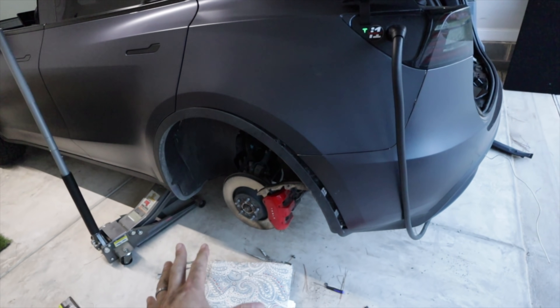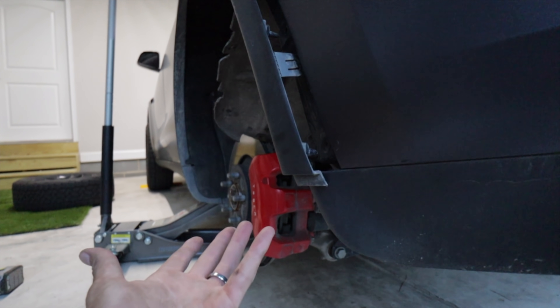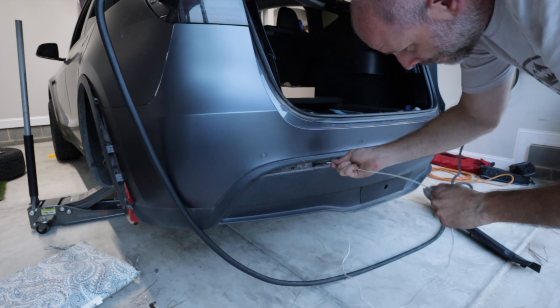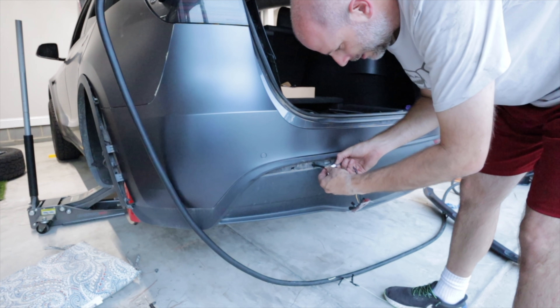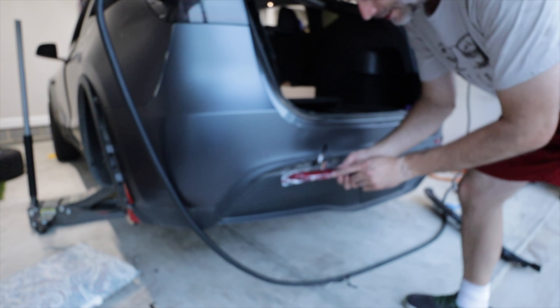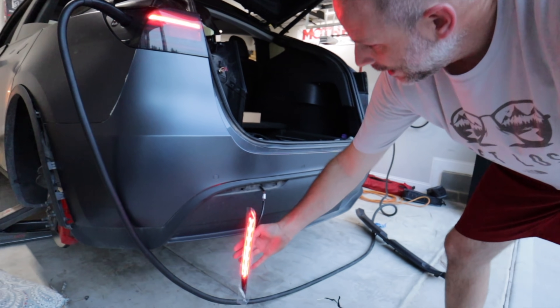You might have noticed I took the wheel off because my tires are much larger, but I think on the Model Y you need to anyway, just so you have enough room without having to unbolt anything. I think if you undid these right here and dropped this a little bit you'd have more room, but then you're getting into some major things. It's really not that hard to take the tire off, but you could do this without that as well. So now I'm just going to undo the wires — these are color-coded, so you can't do them wrong. Good thing I checked because this is working, but my taillight's not working, so I've got to flip that wire. There we go — now that's working, and this is working.